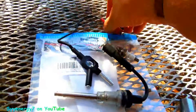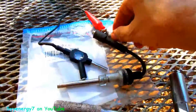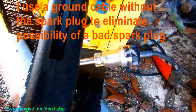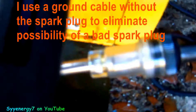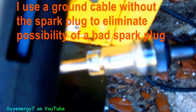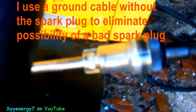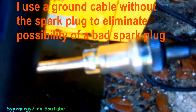It's easier to pull it over with the pull starter. You can do it with the plug in, but I like just taking the plug out and grounding it out. You can just plug it into the spark plug boot and ground it out someplace. This one's designed to be plugged into the spark plug boot, and then the spark plug is plugged into the tester — but I use a jumper cable. You can see the spark tester right there, close up. Give it a few pulls.